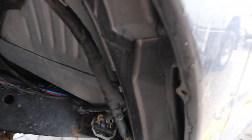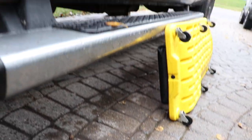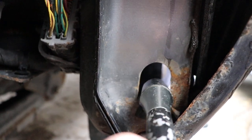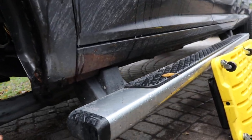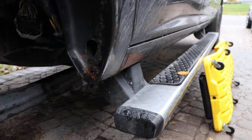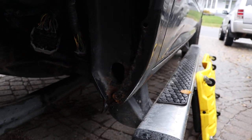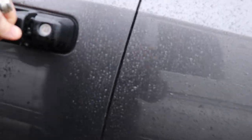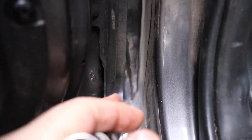When you've got the fender liner out, I really recommend you clean this area and then look inside the rockers. You can take a peek in there and see if your truck is in trouble, because that's where the rockers rot out. I've just got surface rust from wheel spray, but once the rockers are gone you're in for a pile of work. I recommend taking out your liners every couple of years, cleaning this out — you can kind of reach it from the door opening but to really blast it out you have to take the liners out.